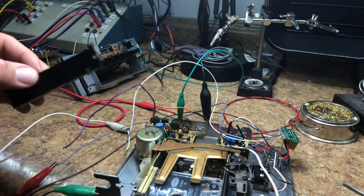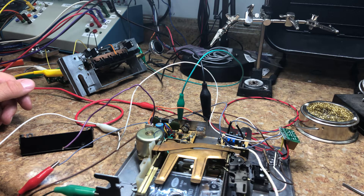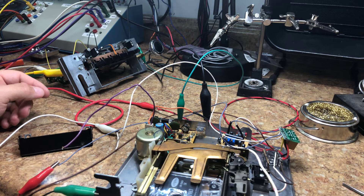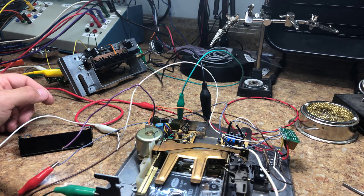The original radio had an LED — yellow for stereo lock or red for tape player. Unfortunately I think we're only going to be able to work in one position, which could be yellow, red, or green. We could also put a status light in there to where it would be yellow for FM, green for aux, red for AM, and blue for Bluetooth — if you want that. Or we can keep it stock with the yellow light. We're going to look at whether we can do a polarity switcher for the yellow and red tape indicator.